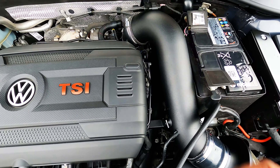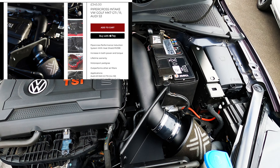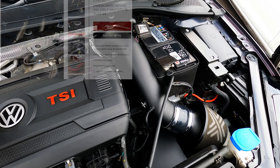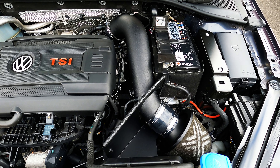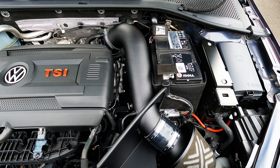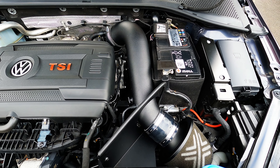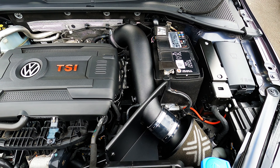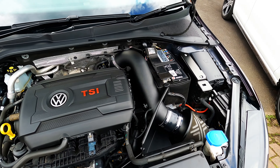The GTI is slightly different because I've also had the turbo muffler delete and replaced the hoses around the turbo with silicon Racing Line hoses as well, so it's had slightly more done to it than the R. The Piper Cross came all as one piece at £345 via Motec Performance. Motec's performance stats state that it is 27% wider than the original part and — though I'm sceptical — they claim 10 to 12 more horsepower, or on a tuned car 17 more horsepower. Take what you will from that.